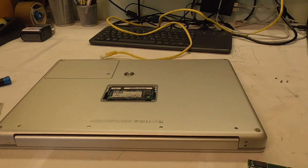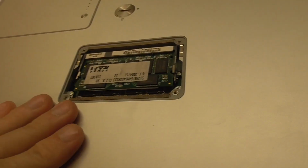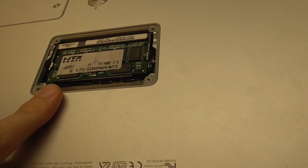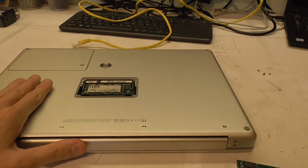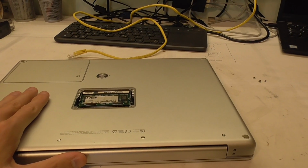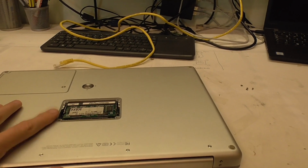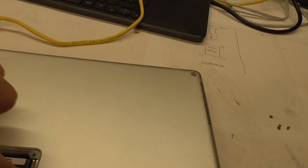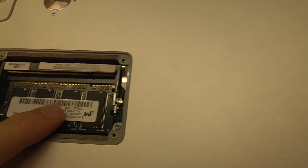Oh well, those Powerbooks, they seem to age. This one has the exact same problem as the other one. The lower RAM compartment doesn't work, so that seems to be a really widespread issue. I just remember I bought those two apart from each other. They're probably made in different years, and they have the exact same problem. Really weird. One of them gets recognized, the other one doesn't. I do not think it's because of a dead RAM stick. It's probably just another dead compartment. So that one, the 256, that's not recognized.